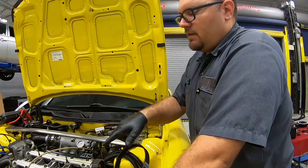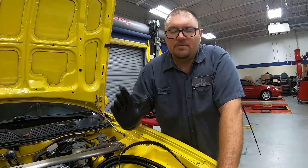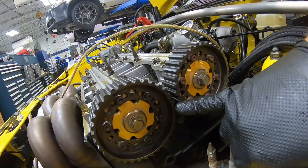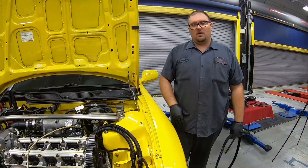We got the bottom pulley in, it's time for the timing belt. We're going to make sure we're on time — it should still be on time from when we took it off because we set TDC before we removed the old belt. On an OEM cam setup, you have these holes in the oil runners for the VTEC runners, and you set the motor to TDC and pin them. Aftermarket cams usually don't have that hole. On the cam gears we have our timing marks — these two touch each other, these two point up, and that lets us know we're on time. We already know we're on TDC number one because our crank is on the mark at the bottom. Now we just put the timing belt on, release the tensioner, rotate it, set the tension, and we're good to go.